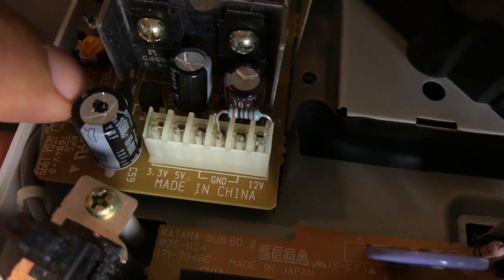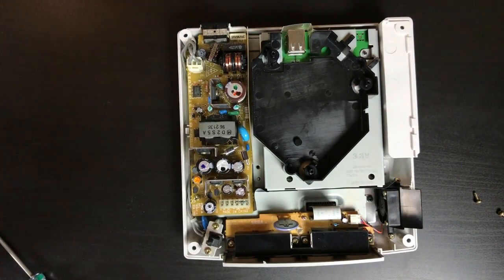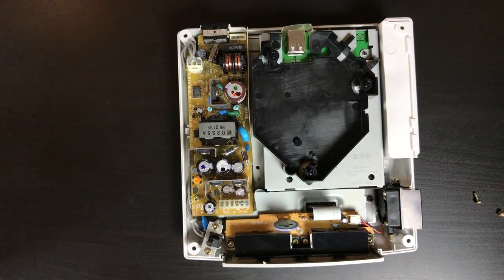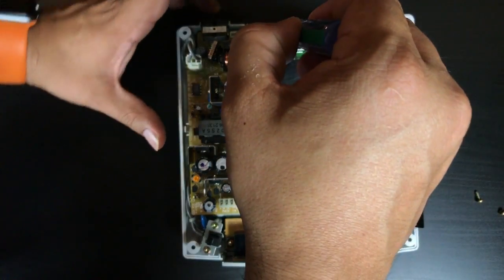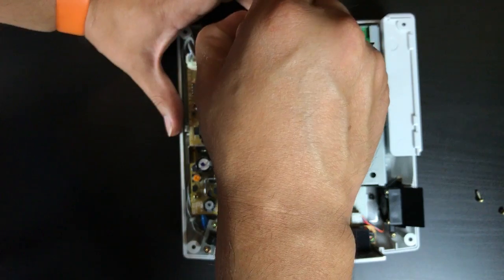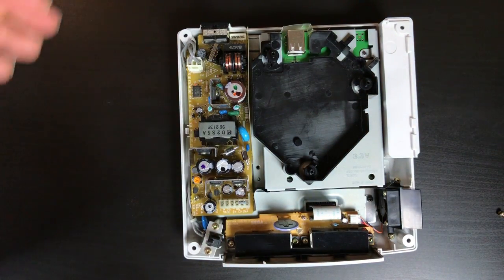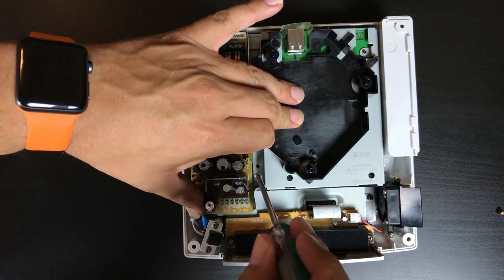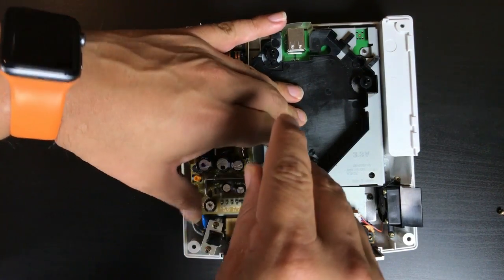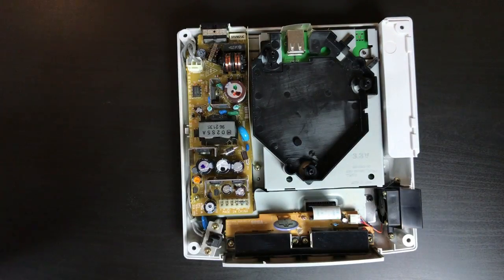Because the last thing you want to do is burn out your power supply, or potentially burn out the board — the board wasn't cheap, but it's definitely well worth it. So assuming you've installed the board, it's just screwing those three screws to hold it down. Even then you don't have to, because the board's pretty snug once it snaps in, but to be complete you should screw it in, in case you move your Dreamcast.